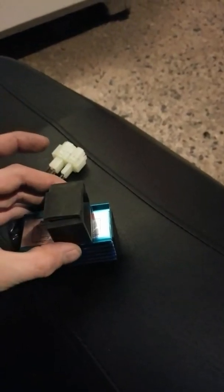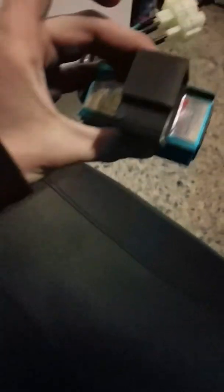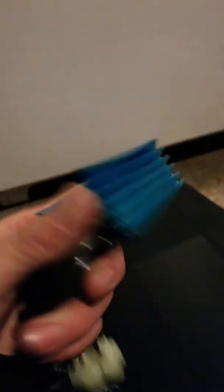You've got this little rubber flexible boot. What you can do is take it and put it on your other CDI — just slide it on over like this. Then you can pop it back up in place because there's a little side tab on each end. You can open it up a little bit and slide it up so it sits on here like this, slides up in place, and that way it'll hold it so it's not sliding all over the place.